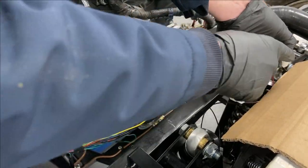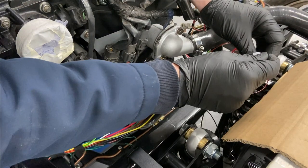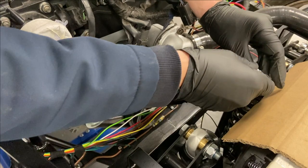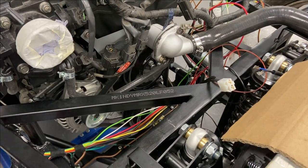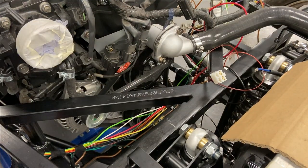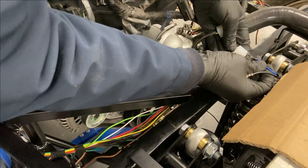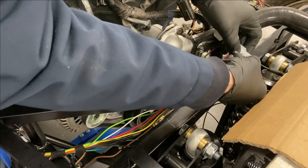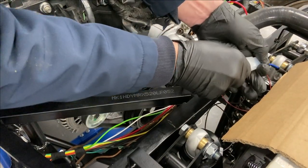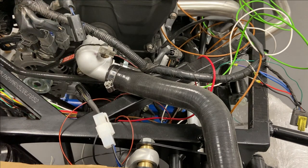I'm going to unpin them and put them into the right positions. In there there's a little tab - all you do is push the tab down and that should come out. You can see the little tabs in there. To get it back together again, you lift the tabs back up, making sure you don't stab yourself in the finger, push the tabs back through - two little tabs. Make sure that plugs in. I've got my blue which is that one - blue to yellow, black to black. If it spins the wrong way, you just swap those two over. That loom is now going to come round there and up over the top.